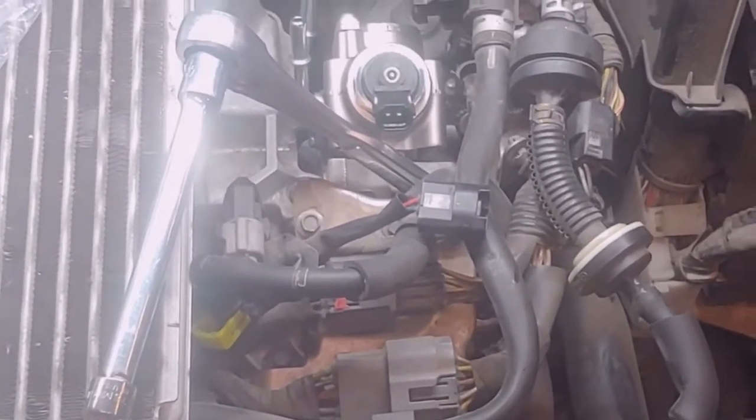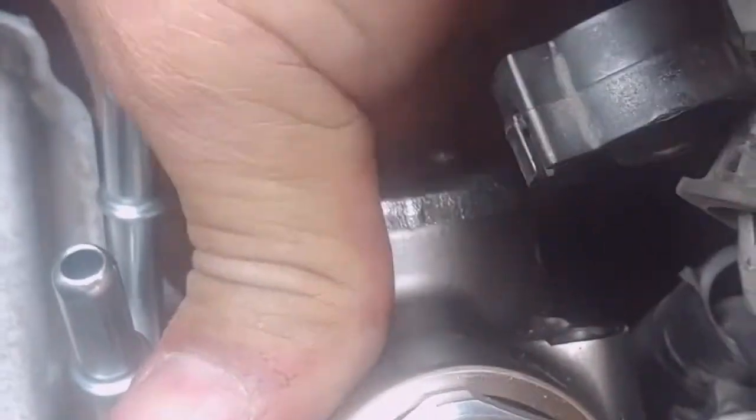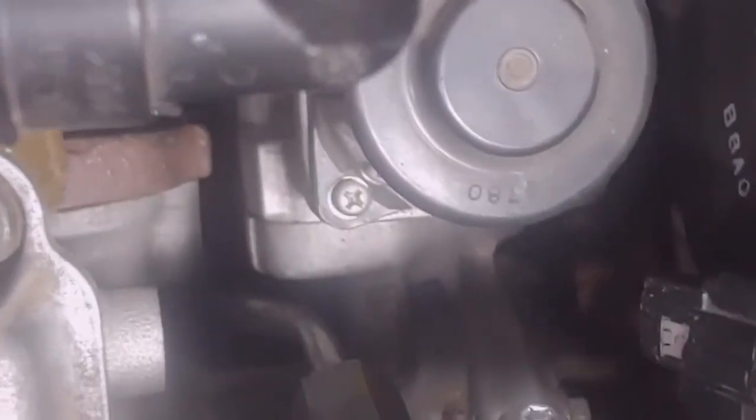All right, here we go. All right, so with 2 hands, I was able to do it. You got to make sure you hold that nut in the back up, otherwise it's gonna fall down, which happened to me, so I had to retake it off. I need to hold it up and then wiggle it back in place. Right now, boom, it's right there. It's seating, but not all the way, which is okay because there's a little bit of tension on that line. As long as you have like 2 or 3 threads on there, you're okay. Then it's just a reverse order.